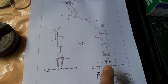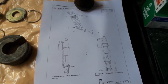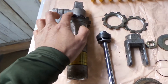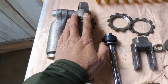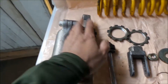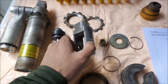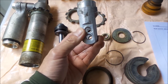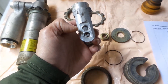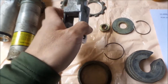Basically, the way you can lower the bike is through these collars — though you're not supposed to lower it with these, that's the effect it has when you adjust them. It raises or lowers the spring, but you use this to set your sag. The appropriate way to lower it is to move the bolt from the lower hole to the upper hole. It lowers it like an inch or so.